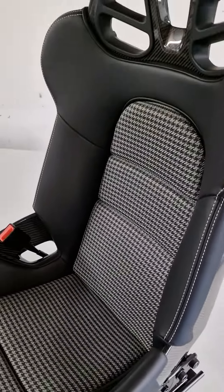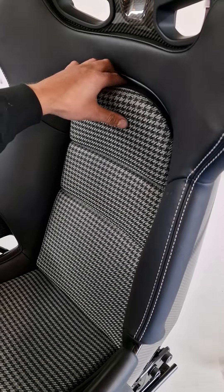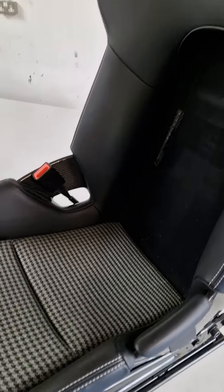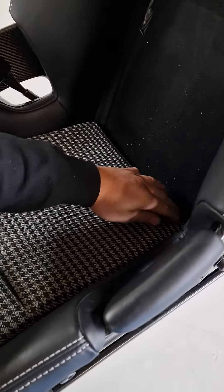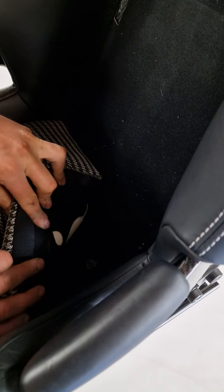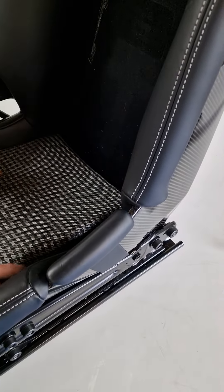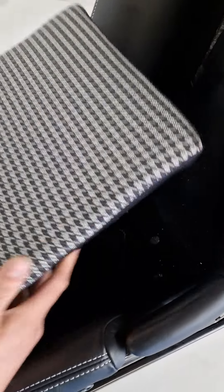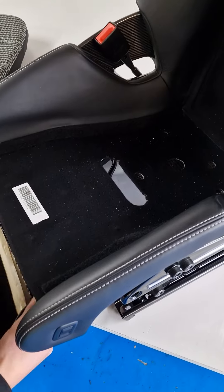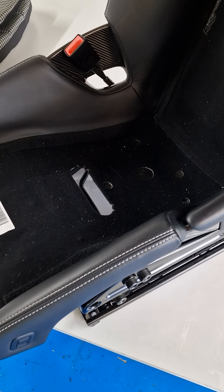The first thing you want to do is remove the center cover — the center section. If you're replacing inserts it's just easier to do this. You can lift the base section up, but on 2021 seats there may be a couple of clips in that position which you push down and unclip to free it up — one on either side. On this particular seat, because it's a 2020, it doesn't have them. We prefer to take these covers off, which are easily replaceable — just look at how to put them back on in our cover installation video.